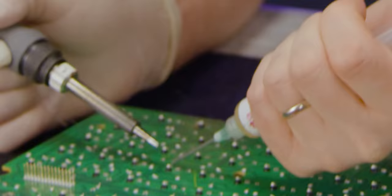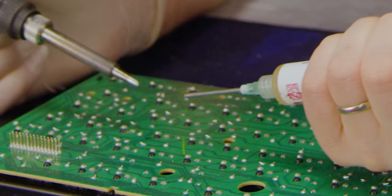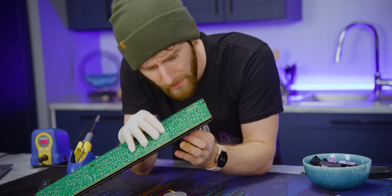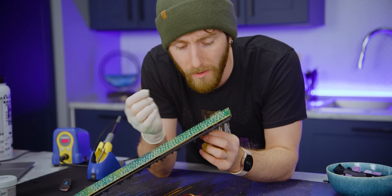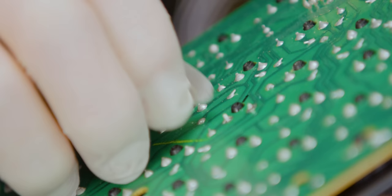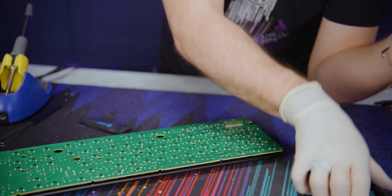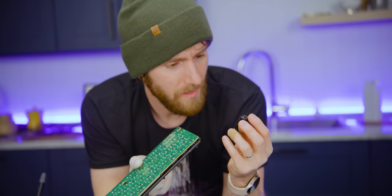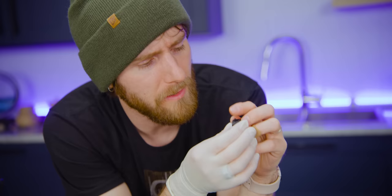Okay, let's go ahead, oh, I hate these things. Here we go, boys, we're gonna wick it up. Now this is interesting. SteelSeries, or whoever their OEM is, apparently saw fit to bend over the little stems from the key switches. So I can't just pull it right out without bending these little tabs back. It's also not quite there in terms of being fully wicked. I think we gotta lift that. There it is. There's our Cherry MX Black switch.